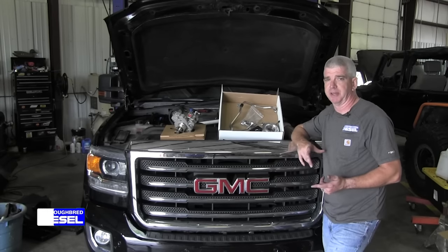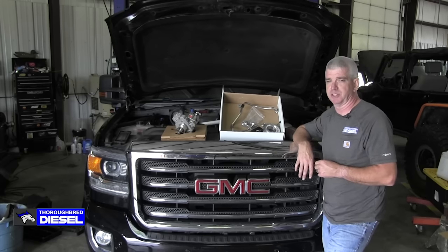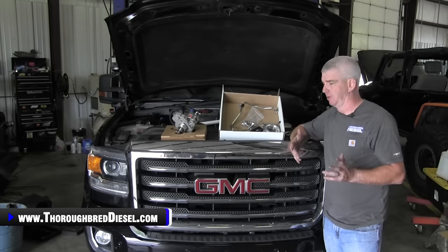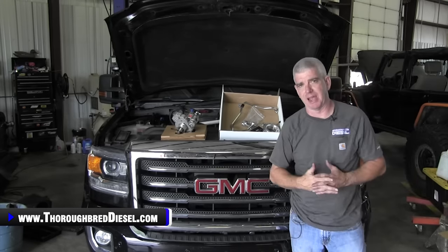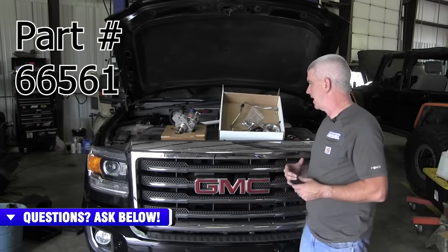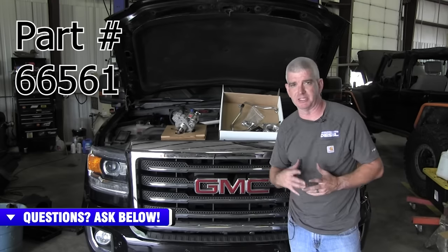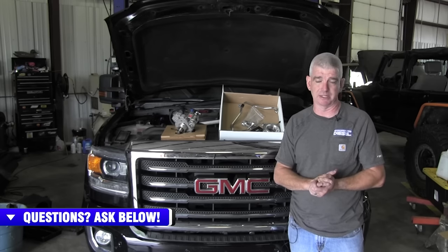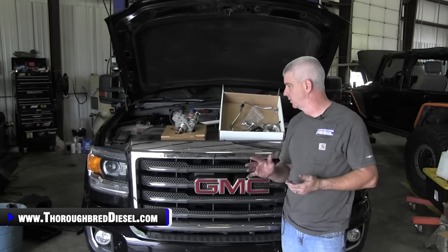Hi, I'm Wade from Thoroughbred Diesel, and today we're going to be installing Fleece's LML CP3 conversion 50 state legal kit. Fleece was one of the first companies to come out with the CP3 conversions, battling the known failures that we have with the CP4 in the LML trucks. Now, the 50 state legal kit is going to be a CP3 conversion that is going to leave all emissions intact and has an EO number on the pump, so it's good to go.